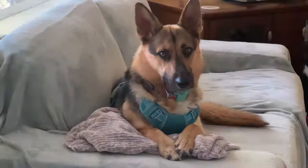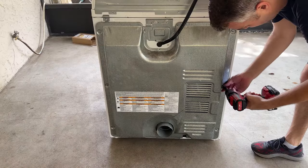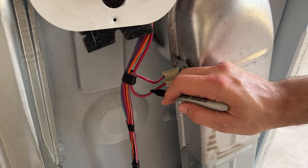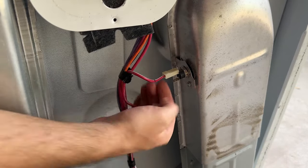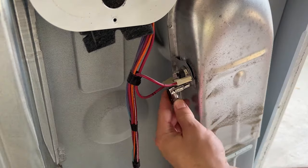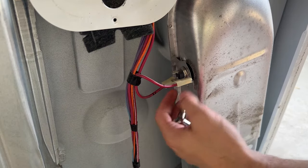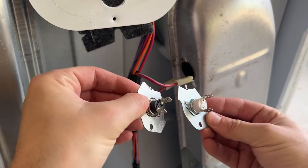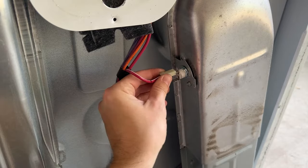Even baby girl has lost interest at this point. A screw here, a screw there, and we're back to the guts. I decided to replace all of the remaining components, starting with the thermal fuse. I marked which cable was plugged in where just to keep them straight, then pulled the cables to disconnect them from the terminals. I couldn't get my drill in at this angle so I had to use a socket wrench to back the screw out. Once the screw was out the fuse comes right out. The replacement part looks pretty much identical to the old part. I put the fuse back in place, put the screw in, and reconnected both cables.